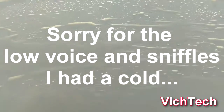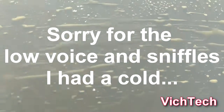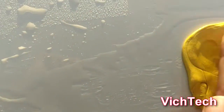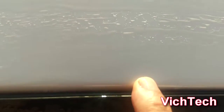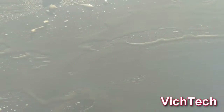You also might see it's coming off. You see it looks like a water spot or a hard stain, a rust stain. There's another rust stain right there. Spots here. Let's get rid of these. You want to take your time. You don't want to press too hard. I've seen the clay bar in some instances remove. See how it's disappearing? I want to just keep showing you the progress. I don't know if you can see that. See, this removes even the swirl marks.